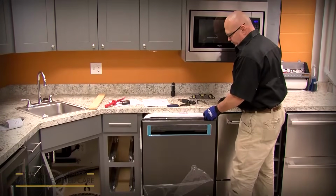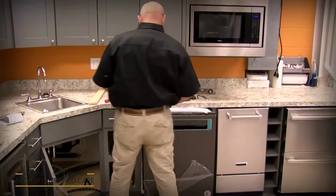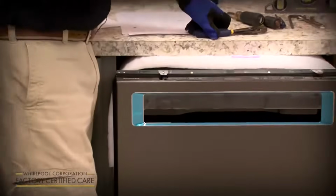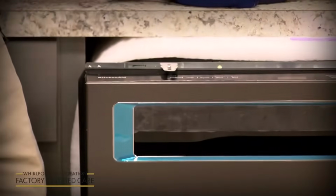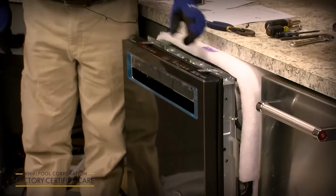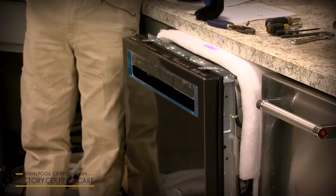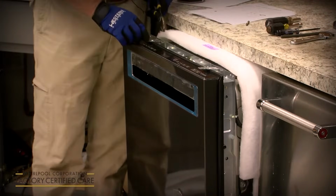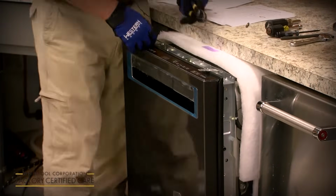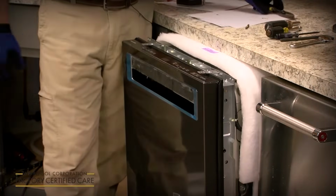Another improvement that we made for this model line is our top mount anchor points have always been in the same location, and you can only put a screw in the wood so many times before it strips out. So we added 2 more slots. So if needed, you can move the anchors in or out to find fresh countertop. So once you get them in the slot, you just take a pair of pliers and bend the tabs or the ears on the back so the anchors are locked in.